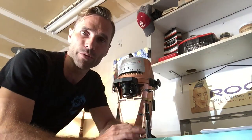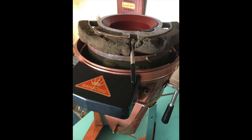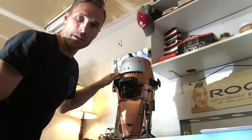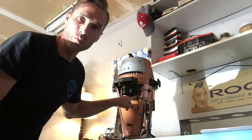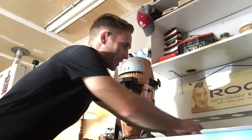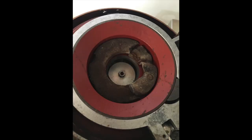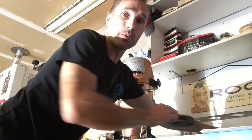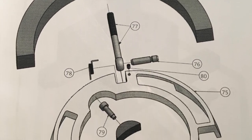Not only do I want to replace my burrs, which is just good standard practice, but some of the foam was wearing out. That concerned me because foam is cheap and easy to replace, but I don't want foam particles getting in with my coffee. There's foam around the adjustment collar, foam where the grinds come out, and more on the inside — including this little donut piece. The donut was really worn out and brittle, sitting between the hopper chamber and the grinding chamber where the discs are.